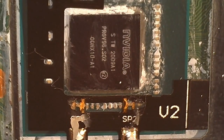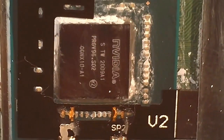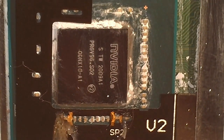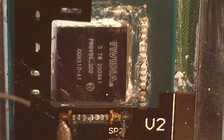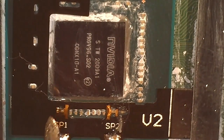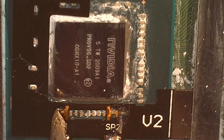The ideal way for me is to have enough solder on my tip, not too much, but a nice, decent bead. Start little, and if you need more, go a little bit more. Ideally, you should be able to just touch the pad here, and it will tin itself, not needing to feed solder in as I do here. Most of the time you can get away with just having a bit on your tip, but once it's all tinned up, then it's good. I like to get everything situated for the most part, and then I come back in and clean up those joints. So that's locked in there.